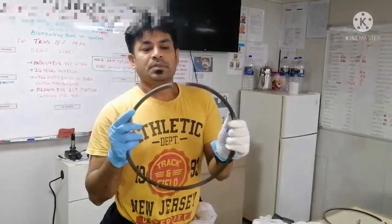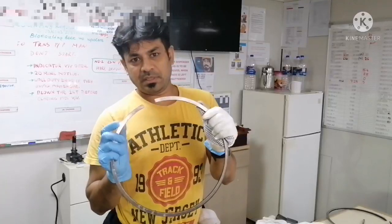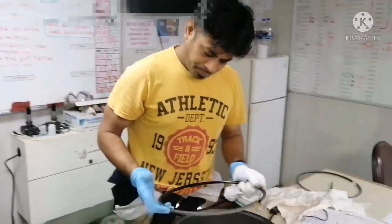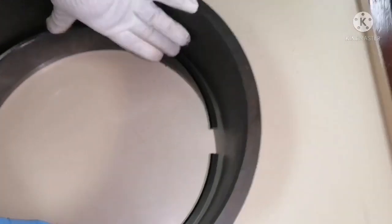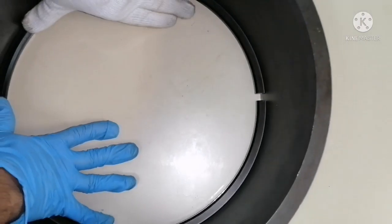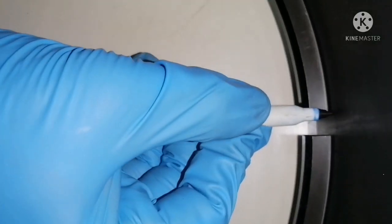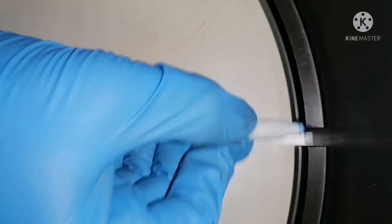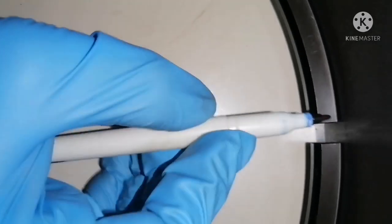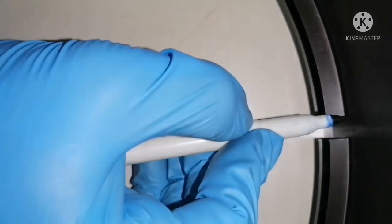This is your second ring. All the other three rings will be the same shape — they don't have that groove which we saw in the first ring. Again, you have to insert the piston ring inside the liner. The gap between the two ends is called butt clearance or ring gap. This is how you measure the ring gap or butt clearance for the piston ring.